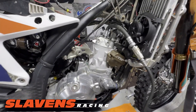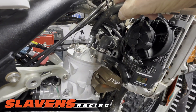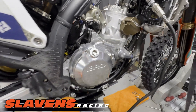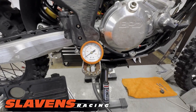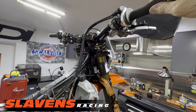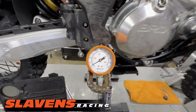They're a little bit tricky to screw in — you've got to use your hand on one end and your other hand on the other end and kind of bend it to get it started. I've rigged it up here in the foot peg so that you could see the gauge. From there, I'm just going to push the starter button and hold the throttle wide open at the same time, then just push the button until the gauge stops moving.